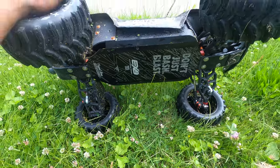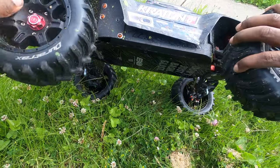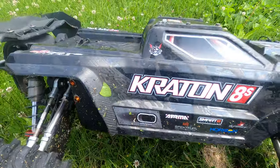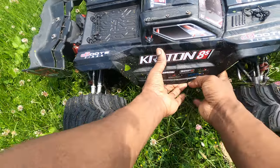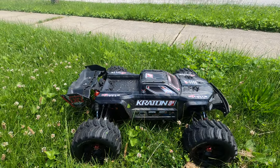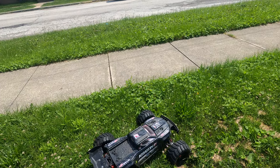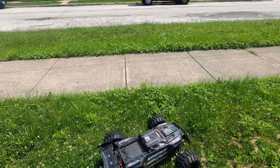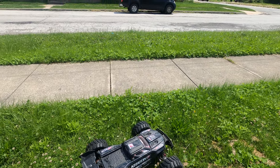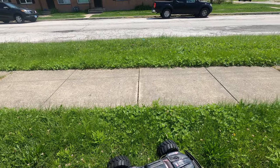I did replace all the bolts because that ramp took all the bolts out. I would love to find some actual 12.9s for those bottom bolts. When it comes to those countersunk bolts, it's hard to find them in anything other than stainless steel or 10.9s — literally stainless steel or 10.9. And all of the bottom bolts, when it comes to M4 or M5, it's stainless steel or 10.9. This uses M5 bolts down there.